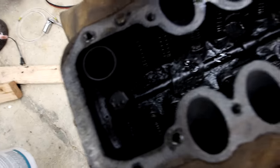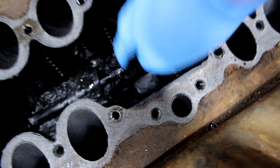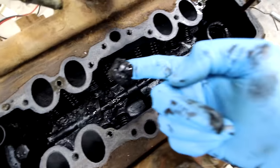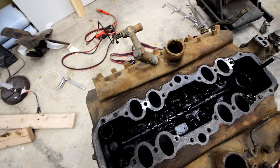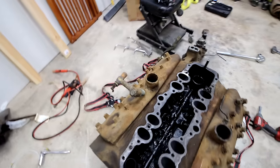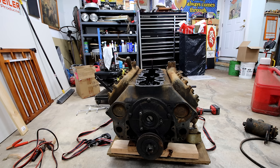It's not bad — I've seen worse, but it's not great looking. It's like gross sludge everywhere. So all that's going to need to be cleaned. Main thing is I'm going to take a socket and put it on the crank pulley and just make sure all the valves and everything are moving, so at least I know I don't have a problem somewhere else. That's why we have low compression — the rings may just be stuck because it's so old. I believe the car was sitting since the '60s. It may just be a case of stuck rings, but it starts still — it may just need to be run to get freed up.